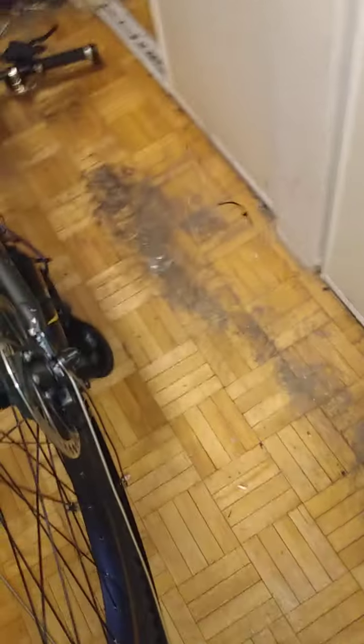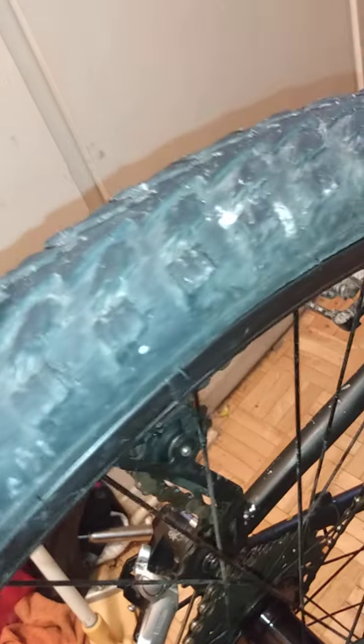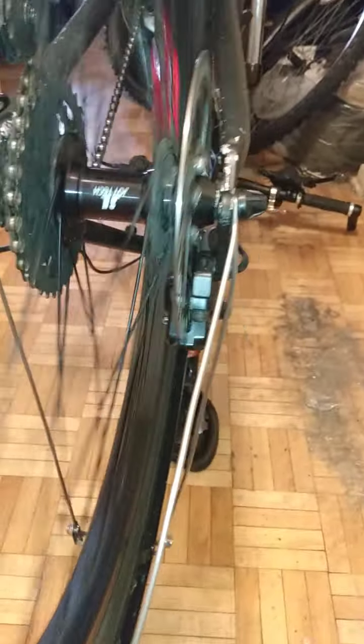Now, there's two ways to sight them. You can sight them from over top, but I've always found that very difficult. It's actually easier to sight here. The problem is, on the rear, you cannot do that because you need the bike upside down, and you want this because then you can have these spinning, but on the back, that means you have to sight from here, guys. And I highly recommend taking your phone just like I did for you guys. Zoom in until you can see it clearly, just like that. And then look very closely and you'll see that it's spinning right in that little gap. Even if it's got a little tiny warp, as long as that warp fits in the gap and doesn't rub on either side, you're good to go.